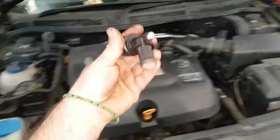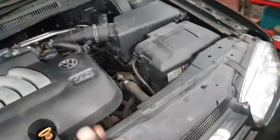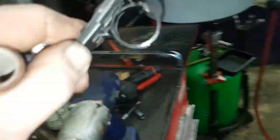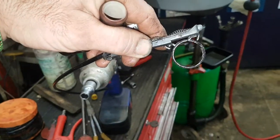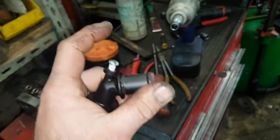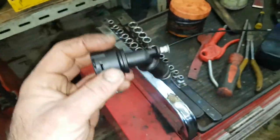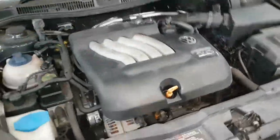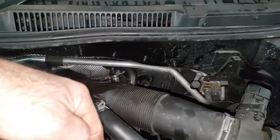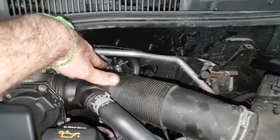That clicking — don't worry about it. When doing this job, a bit of silicone might help. I had a lot of trouble with that, and obviously with the clamps — if you guys don't have this tool, you can see it's still there from last night. I love reusing the same clamps, but this clamp — unless this tool is about to blow up — this clamp made my life miserable. I couldn't get this hose off. Normally on Volkswagens, once you undo the clamp the hose comes off because it's plastic. Combined with a few injuries from yesterday, it just made my life a misery — so it's a good example that it's a simple quick coupling but overall I still spent 45 minutes just to do that job.